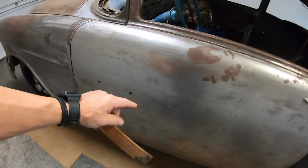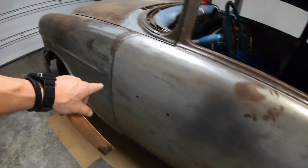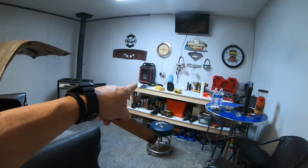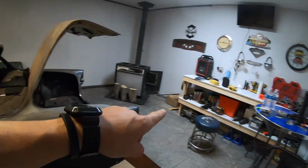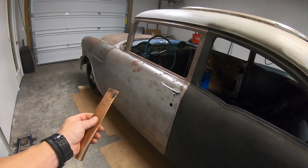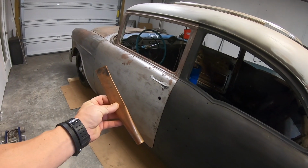And then especially with these big flat body panels, guys, take your time. And that's what we're going to be using the damp sponge for. So we'll weld just a little bit, cool, weld, cool, and use the copper where we can. That's the plan today, guys. So I'll set you up on laps, and we'll go from there.